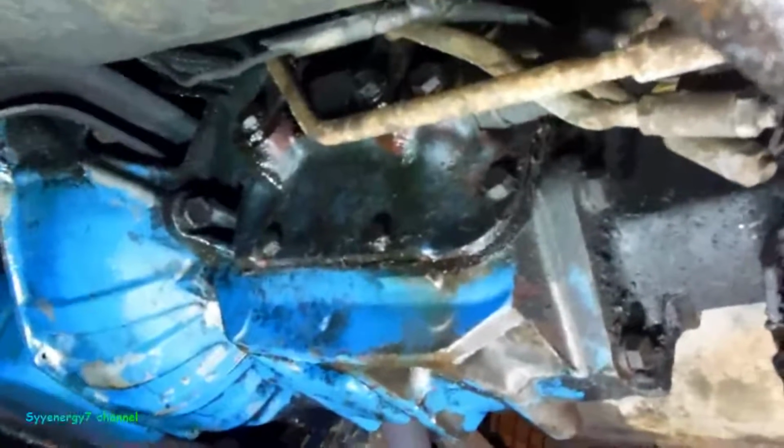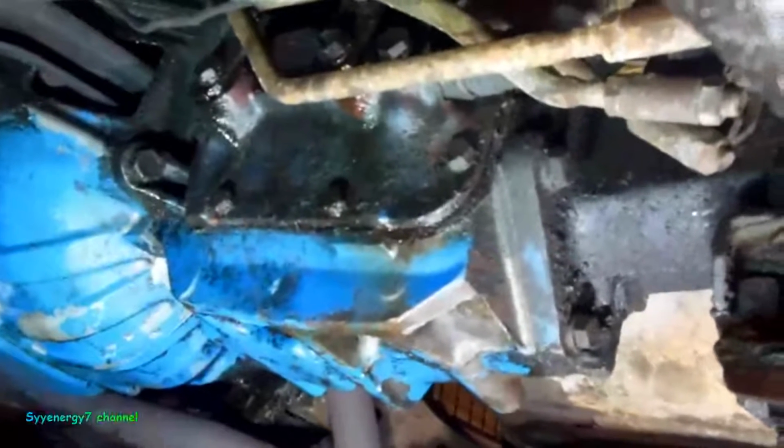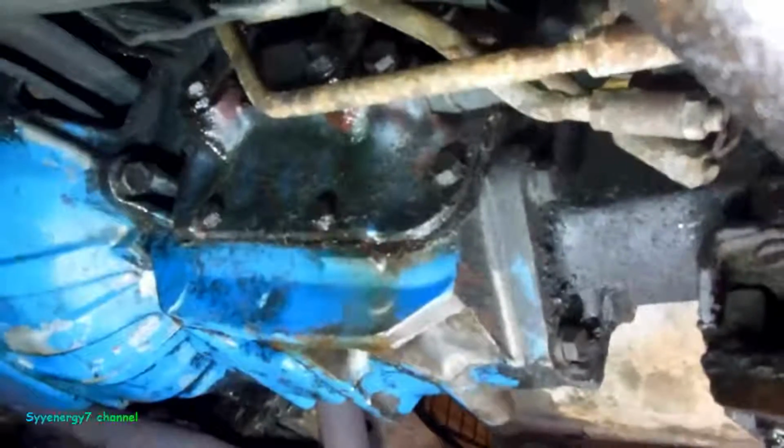Yeah, this is the Saginaw 4-speed on the El Camino. Actually, the 5th generation El Camino from 78 to 87, the only thing they had was Saginaws. They didn't come in any Muncies. They didn't come in any 12-bolt rears. They were just 10-bolt, 7.5-inch ring gear. It wasn't even the 8.5-inch ring gear. That's all they came with.